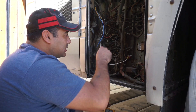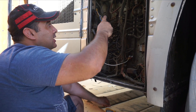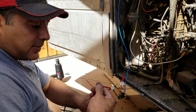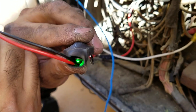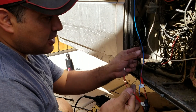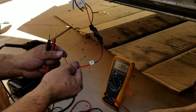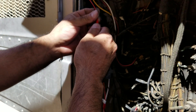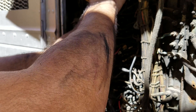So that's what we're going to try — wire into circuit 45, put our USB adapter there, and 5 volts will come out and go all the way to the sensor. We've wired up our 12 volts to the two lines, turned the key on, and now we're checking for 5 volts. There's a little green LED which tells us it's getting 12 volts. We want to ensure we have 5 volts at the output end before soldering everything up. We've got our voltmeter — red to red, black to black — and there it is: 5 volts. Then we'll zip tie it in place.